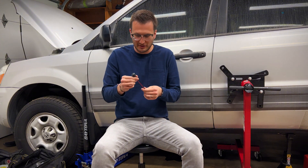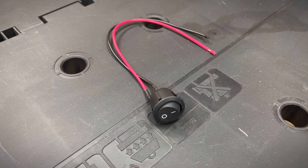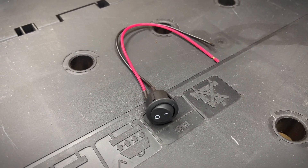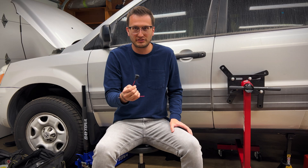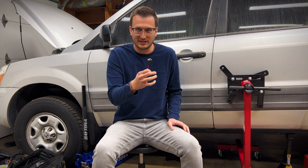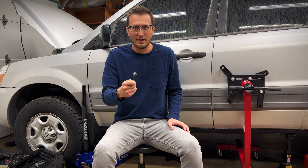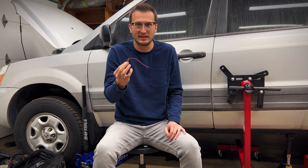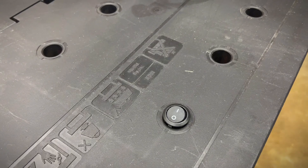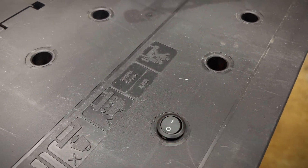Here's what my plan is. A kill switch pretty much always looks like this, so I'm going to make this a fake kill switch that activates a siren. The real kill switch will be installed somewhere else, which I won't show on video for hopefully obvious reasons. The switch for the siren, although it seems simple, has to be a bit complicated. I don't want the switch to immediately activate the siren because then the thief will immediately realize the switch he flipped triggered a siren and just simply turn it off.